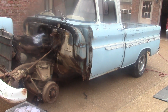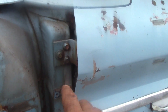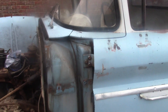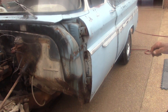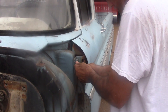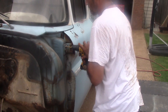All right, I might get these doors off here real quick so I can get to them rockers. I'm going to measure my doors in real quick — we'll take a three-sixteenths drill bit, drill here and drill there so I can line that door back up when I go to put it back on. What I'm gonna do is scratch this in where this hinge is — that'll keep us in line when we go to take it off. Plus I'm gonna drill it anyway.